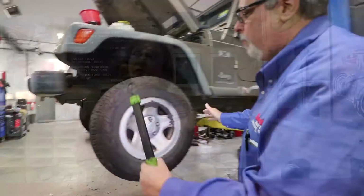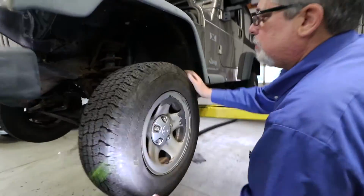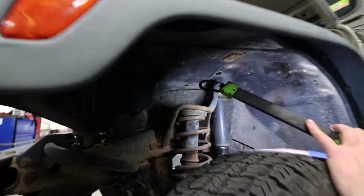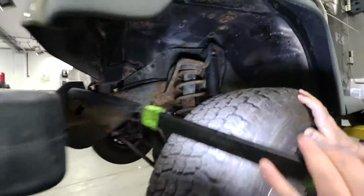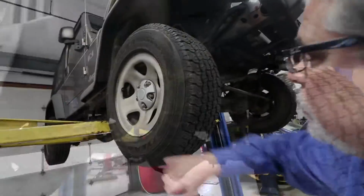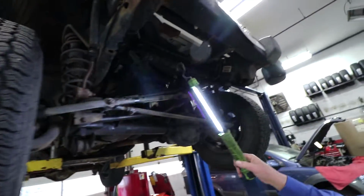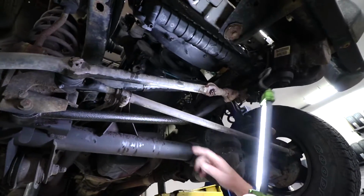What we'll do is put your car on the lift. When we raise your car, we're going to check your tires. We're going to check the pressure and the condition. Now, I have an in-depth video that you can refer to that goes more into the tires. But we check the tire pressure and the condition. And then we're going to look underneath the car. So I'm looking for oil leaks and things of that nature. This particular car has a little bit of an oil leak right here. So I'm going to be a little concerned about that.